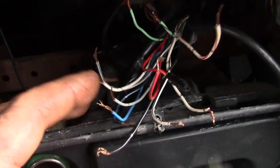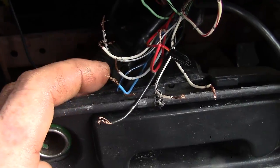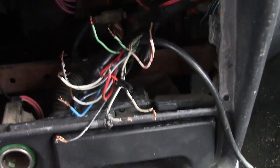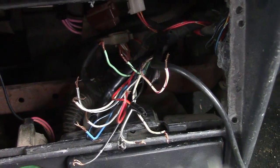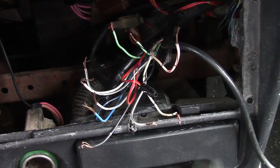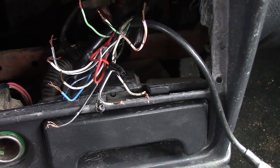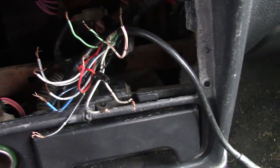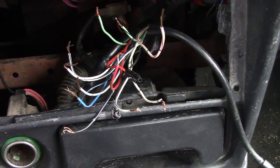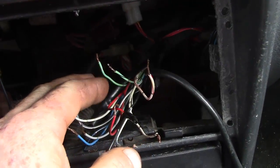You've got your two greens, one white, one gray — two grays — your two blues, your two whites, your two reds. Those probably won't match up with your car stereo wiring diagram. It usually uses purple, gray, green, and white, but again that's not too important. What you want to determine is: okay, you know these two green wires are a speaker wire, but which speaker?